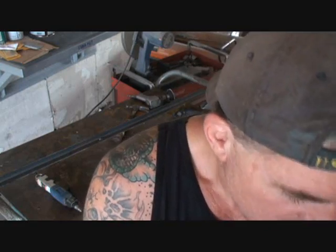I really don't like doing it that way — I'm going to use carriage bolts on the outside. The reason I'm not going to weld the brackets on — which I wish I could — is because we've already done all the bodywork to the firewall. We've already painted it and it's done. If I weld anything to the firewall with the Bondo buildup and all the bodywork done, what'll happen is that'll create heat behind all the bodywork and paint, and there will be an air pocket behind everything. Then I'll have to grind all that out and redo it.